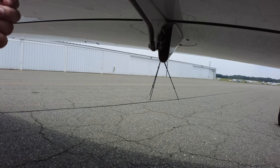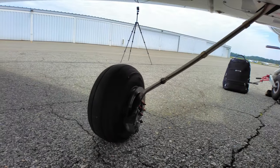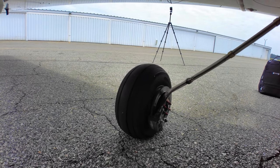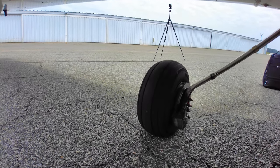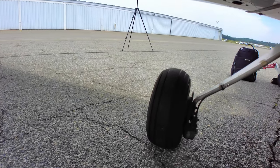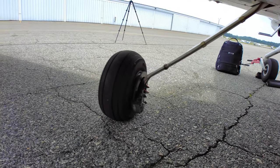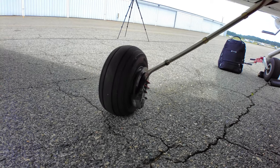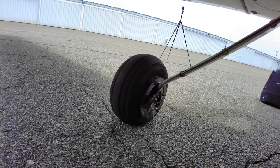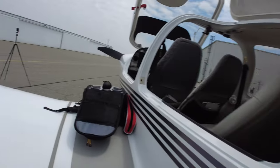Down the flap connection, same kind of check — make sure there's thread showing and it's tight. While we're back here we check the wheels; you can see registration marks on all the nuts to make sure none are backing off. This is tough to see with wheel fairings — they make it look nicer and go a knot or two faster — but we can see the tire condition, brake condition, make sure nothing's dripping, and check the registration marks. Brake line is clipped to the strut — all good.